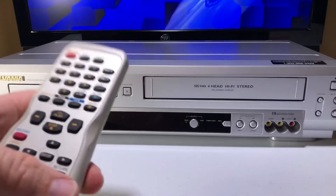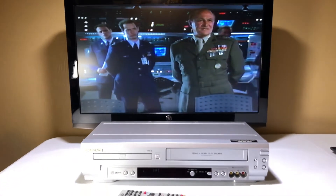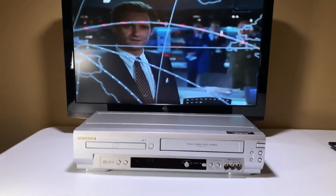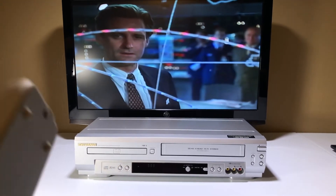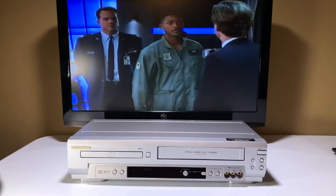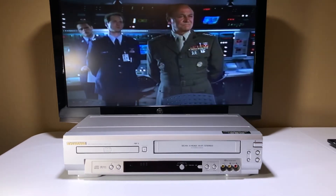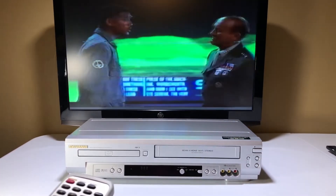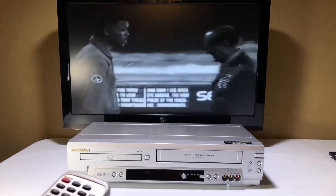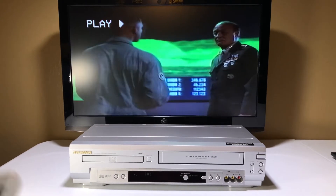I think you have to really manually click over too. So let's go to VCR — there we go. That picture looks fantastic. So we're going to check to make sure all the modes work. Play obviously works. Play fast forward, play rewind, stop fast forward, stop rewind. The reason I do that is because the VCR has to shift gears — literal gears inside have to shift to make that happen. If those gears can shift fine and sync with all the electronics, we have a good unit. Let's hit fast forward. Back to play. Rewind — it goes black and waits for rewind, I like that. Play. Those gears shifted just fine.